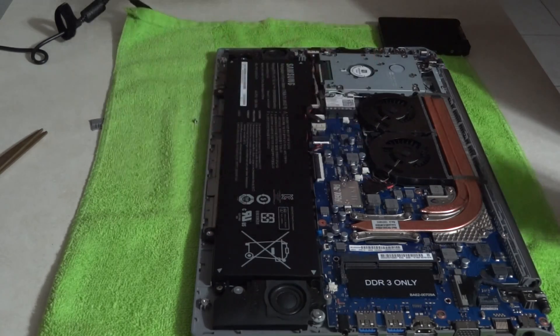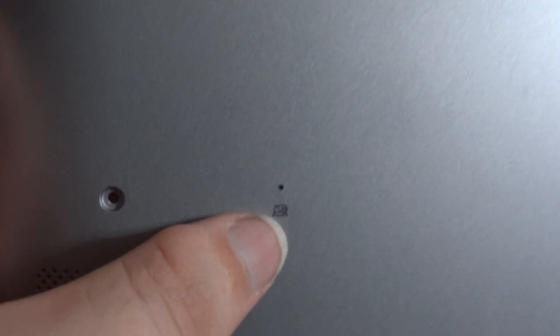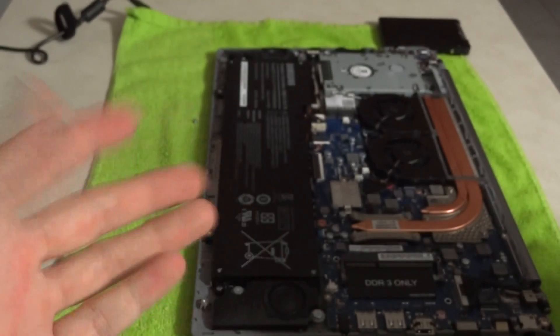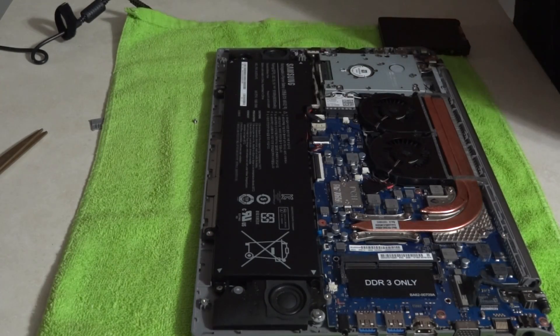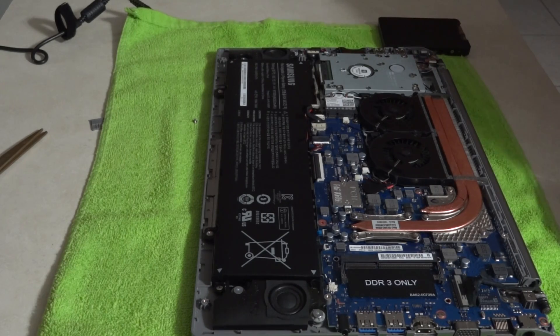The battery seems secure. Letting you know — when you take this apart, it shows right here that there's no battery power. There's a little button you have to push. So if you're going to replace the RAM, which there is a RAM slot for, it's saying you need to kill the battery prior to doing so. The battery is not user-removable, but you press this button on the battery and it goes ahead and turns off for you. That ensures you're not accidentally damaging the motherboard or killing the RAM stick because there's still live power on the motherboard. So that's a precaution you have to take.